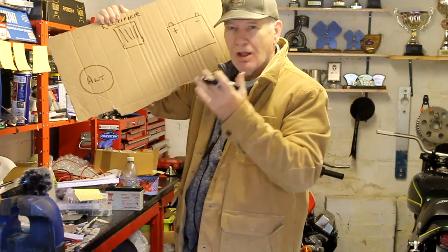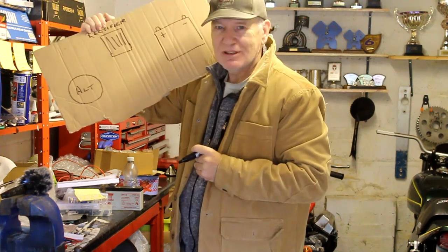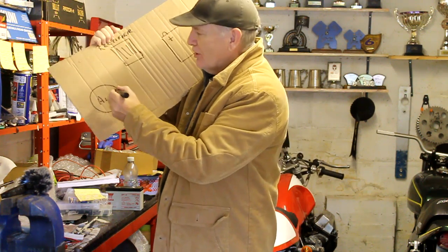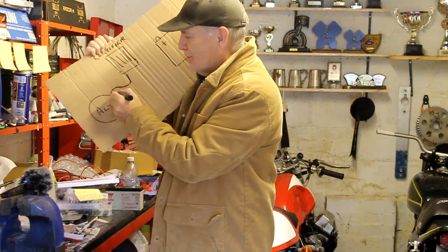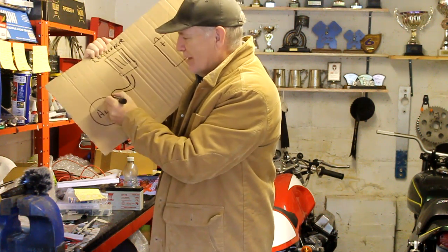Out of the engine we usually find two or sometimes three wires which lead from those tightly bound coils of wire, and those wires go from the alternator to the rectifier. In the diagram we have three wires coming out of the alternator into the rectifier.